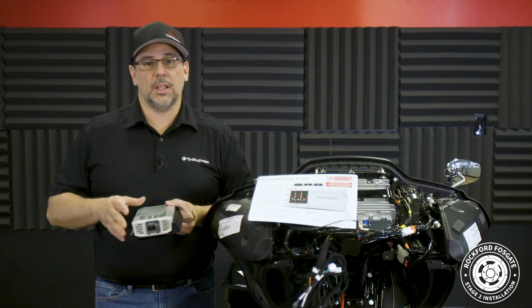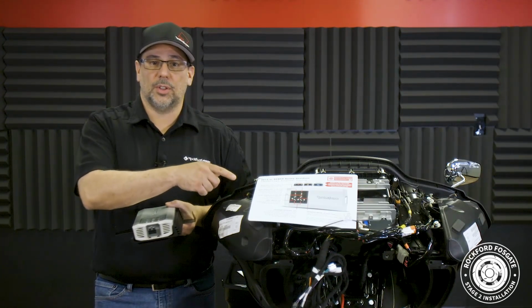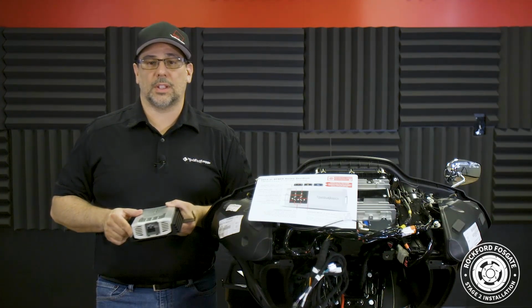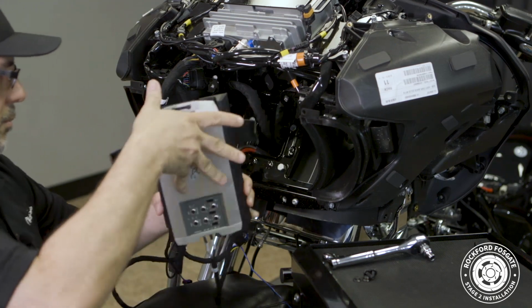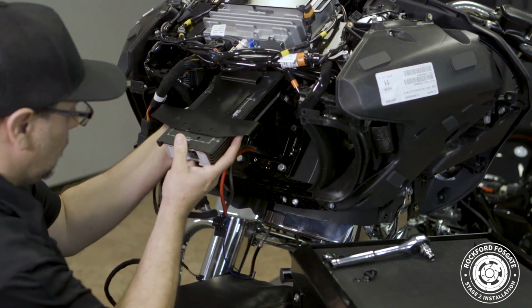Now you'll need to plug in the inputs and tune before proceeding. We offer this free amp tuning guide that's available in the description of this video and through the kit's product details page at rockfordfosgate.com. Now, prepare the amplifier by taking the harness labeled amp input and plug them into the corresponding front and rear inputs of the amplifier.